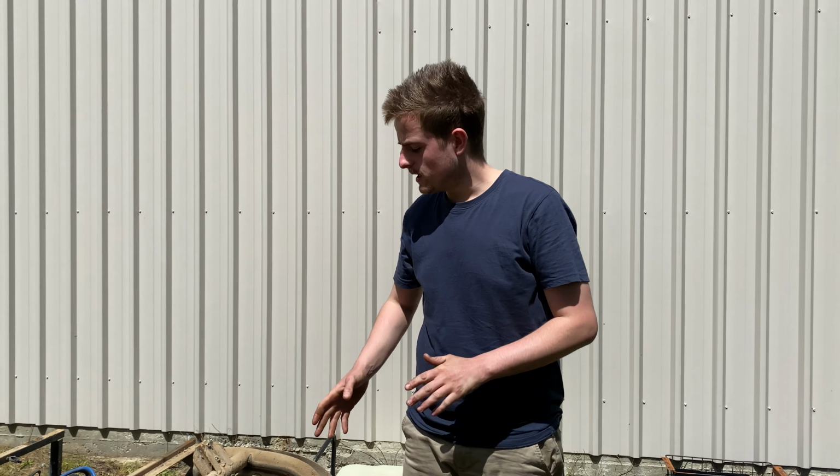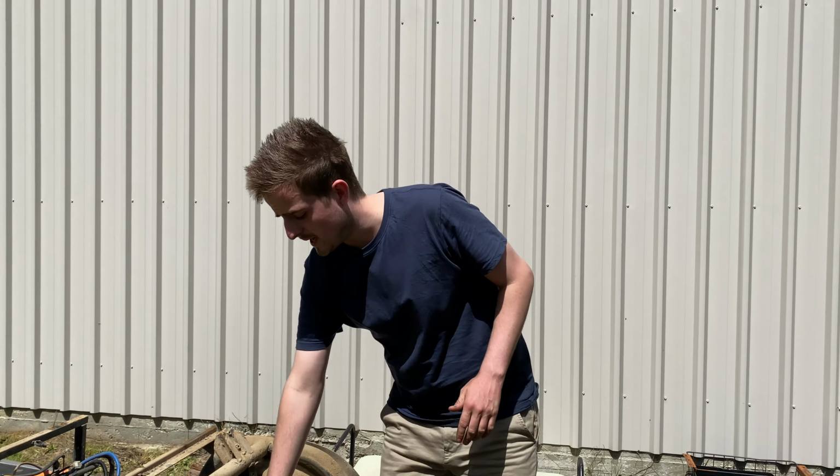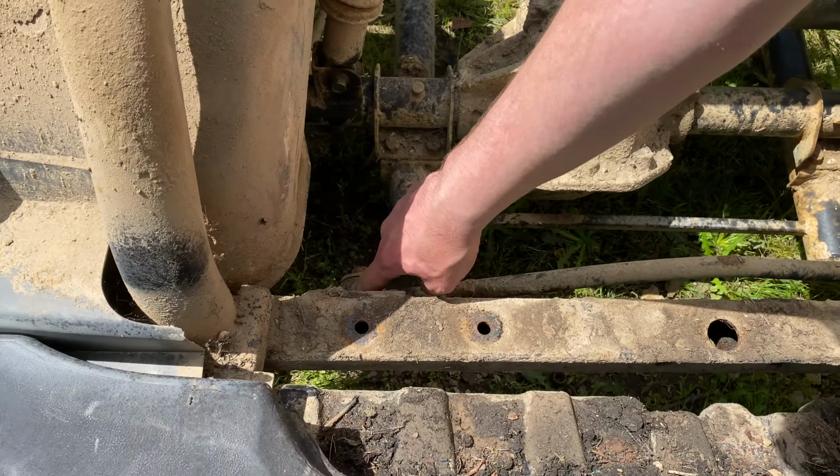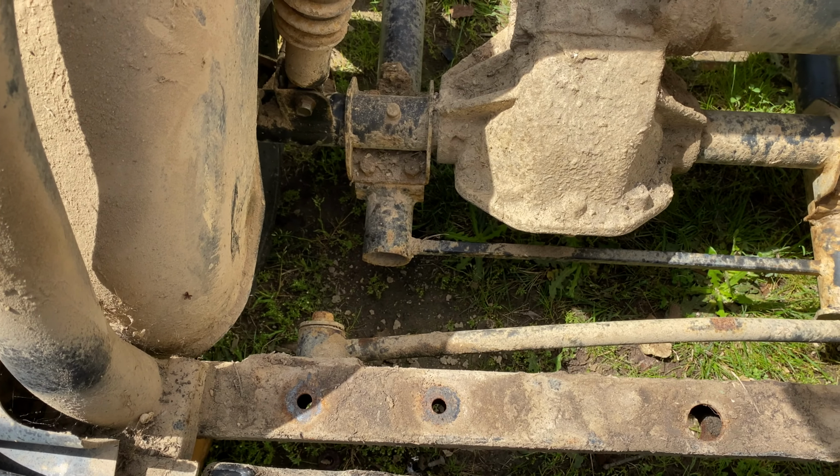That did reinforce the rear end a bit there, but anyway, the next thing, I've undone these shocks, so we'll lift it back up. We have to make a spacer about 5 inches, so I have to do that, and this panhard bar here does need a mount going down, so I need to extend this mount down because we will be pushing everything down 5 inches.